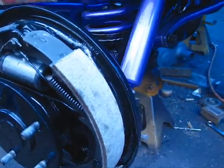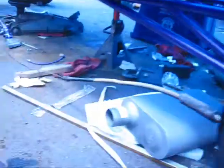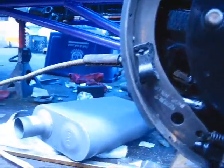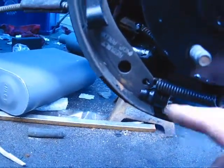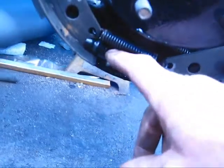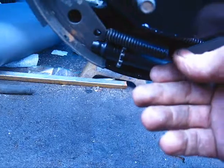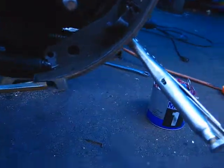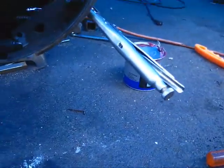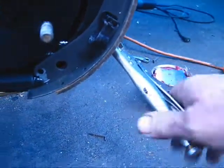What I've done is take a pair of vise grips on the back, holding this front brake forward. So for my next little spring — first you put the inside clip here, this is going to pull the brakes together and also holds it right here on the little star that works the self-adjuster and holds it in place. The reason I put the vise grips back here is because I'm going to pull this brake forward. There are special brake tools but I find just a big pair of channel locks works, or big vise grips.